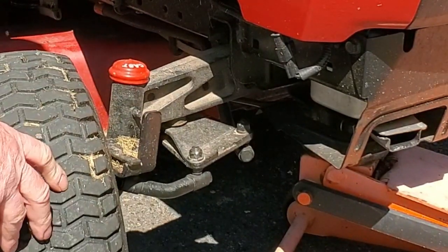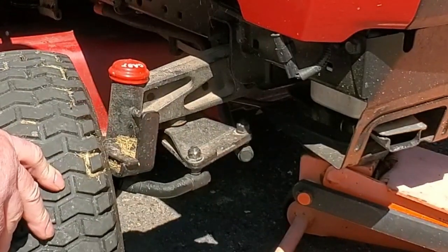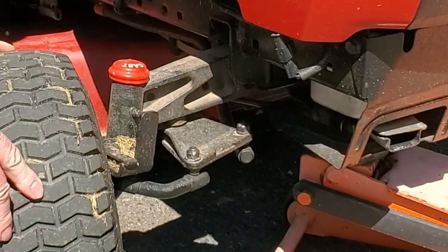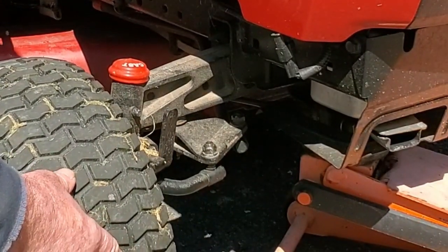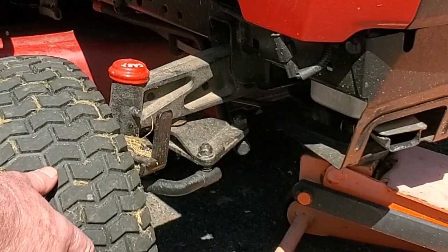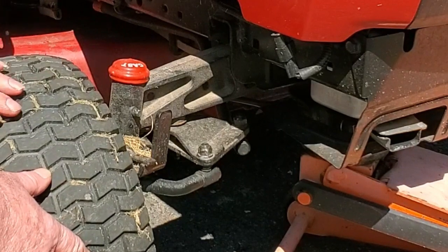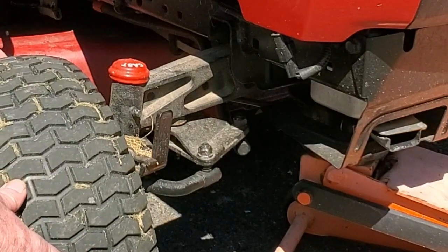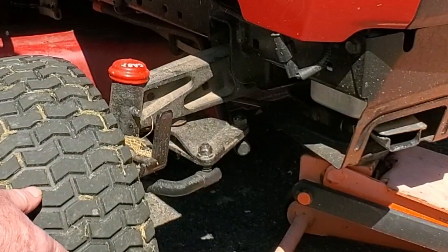The other side of that coin is you have more parts to wear out. So when you're driving this forward and this starts to wear, instead of both your front tires being straight, they start to turn out a little bit. You end up wearing more on the inside of the tire than on the outside, and you lose some of your steering. It's not tracking right.